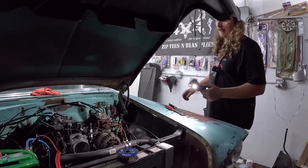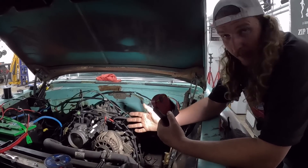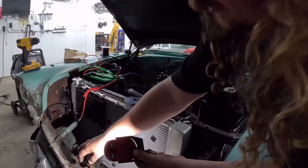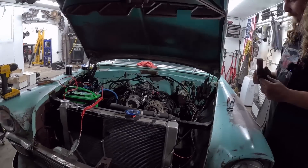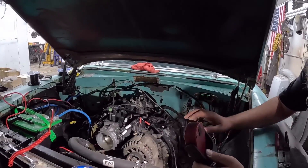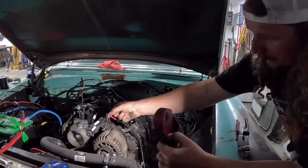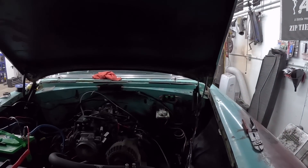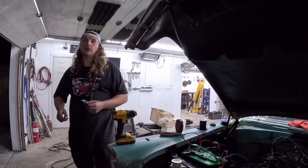On this side, this is the real crucial part. So this wire here — this is where things get a little goofy. At one point this had a small block Chevy in it, or a big block Chevy, or actually both. And the alternator was over there where the battery is. So in this big loom, we go around and you can see where this wire goes in right there — that white wire, that's the exciter wire. I had extended it all the way over there, which obviously an LS is on this side. So I'll have to break into this loom, peel it out, run around and go into there. This is kind of temporary but it works. Remember the whole car overcharged, it burnt that wire down — that's why.